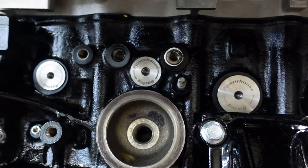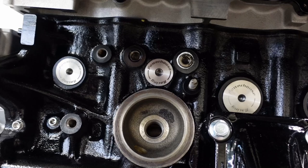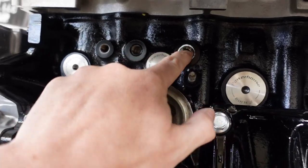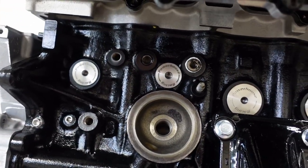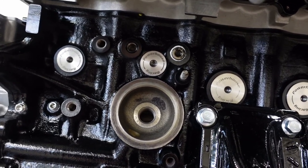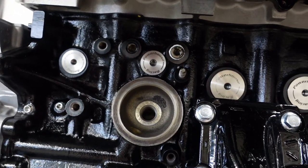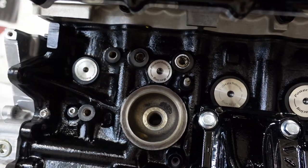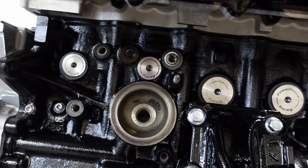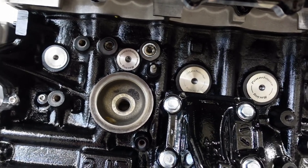They sell this plug — it's a NA plug you can get from Toyota, but it is 3/8 BSPT — British Standard Pipe Thread. Do not use NPT for that. It's just what the Japanese use instead of NPT. I put a little PTFE paste on it and blocked it off. My wife's car has been that way since 2013. It was taken out to have the block built, but I just put it back in — it's the original plug.